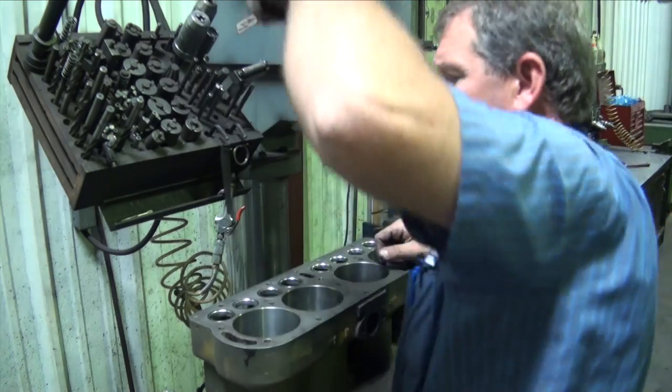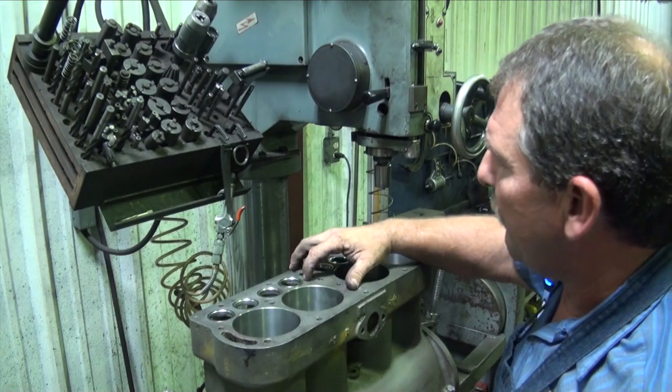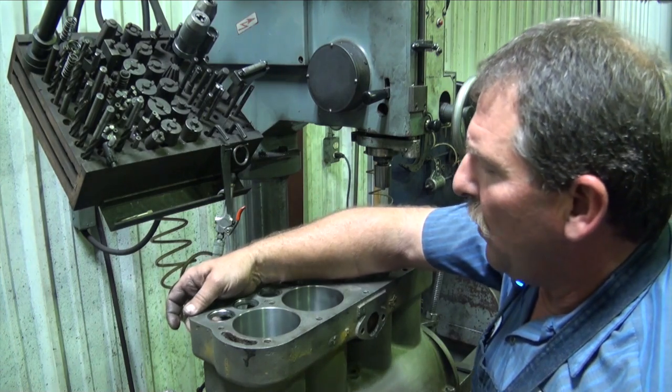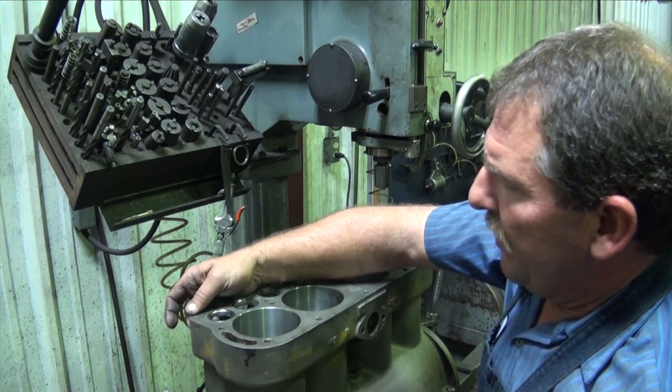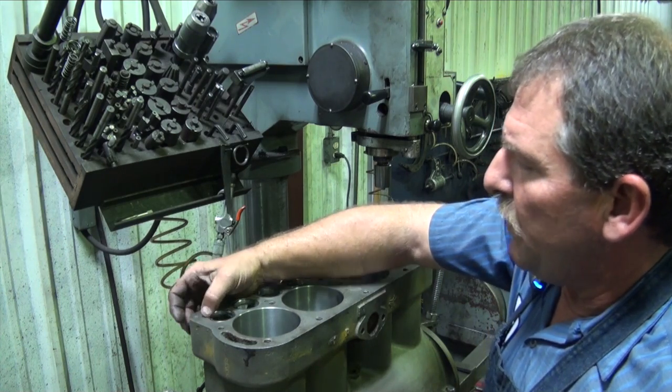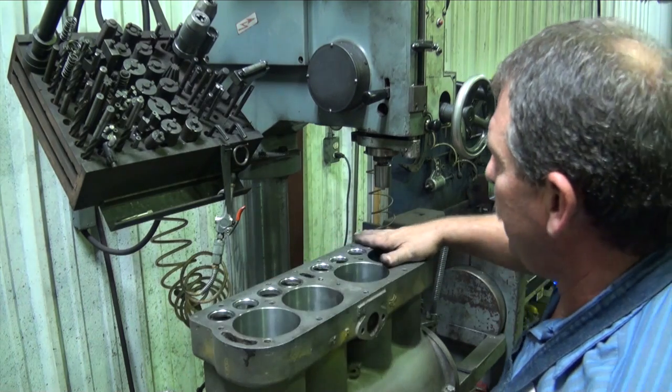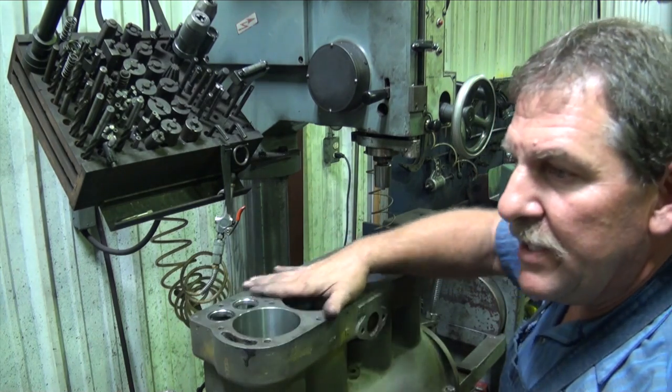We've got our exhaust seats that we've had some block eroded away from, and the problem with the floor of the seat pocket where the port comes through. We've got our seats up just a little bit. We're going to go back in now and trim them down to make them a suitable level for reconditioning the deck.